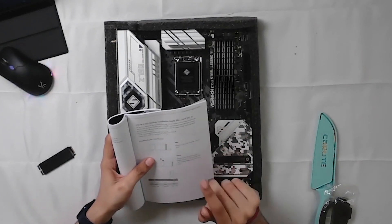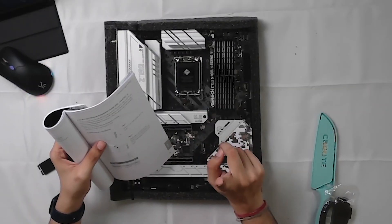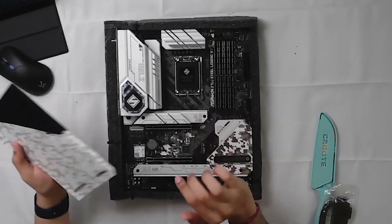Either M.1 or M.2 can be used at a time. We can use any other drive, and in total we have 4 usable slots — there are 5 slots but we can only use 4. If we use a particular slot here, we can consume the GPU bandwidth, so that is not ideal.